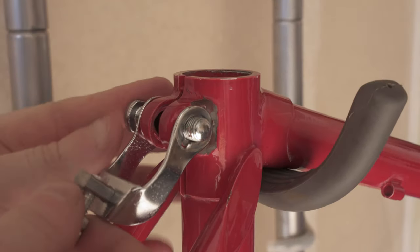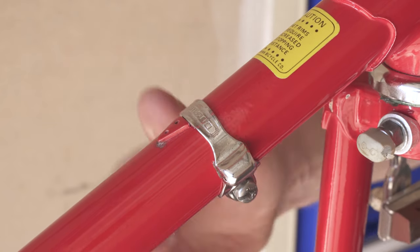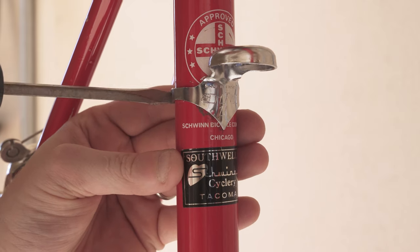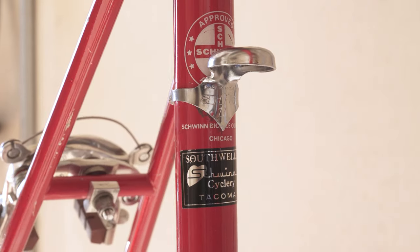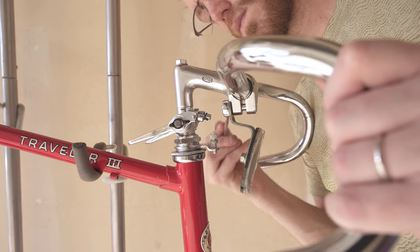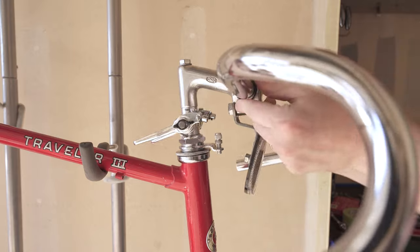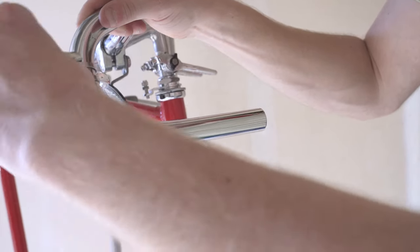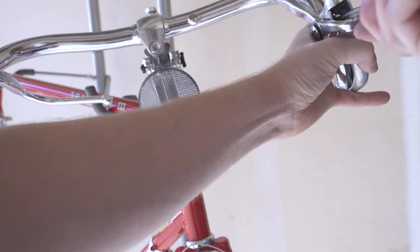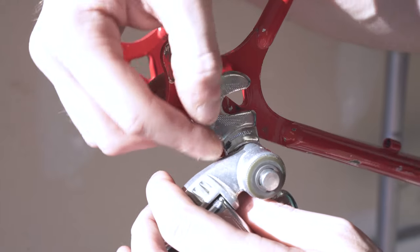Putting the brakes back on, the seat clamp and brake wire holder — whatever you call it, it holds the brake wire in place. There's a cable guide down on the down tube, and this is actually a frame pump holder. I don't have the original frame pump unfortunately, but I love the look of it so I had to put it back. It's always nice to tighten things just a little bit — you'll make adjustments later, so don't go crazy. You can see the safety levers on the brakes; I don't really like those but I decided to leave them on for originality.